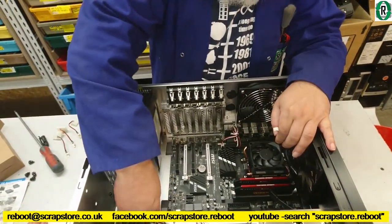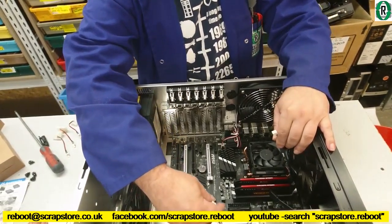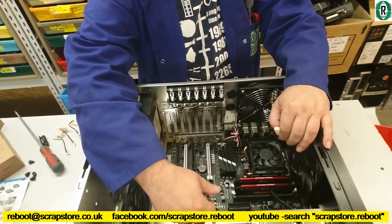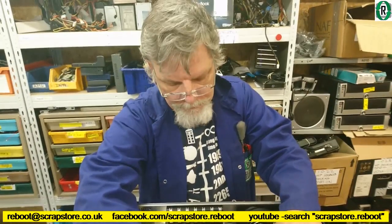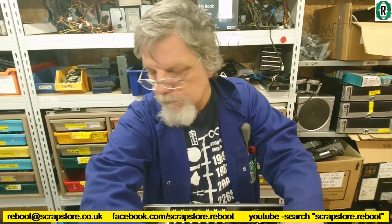How to connect them up. So we've only got two system fan headers on the board. Yes. And three. One, two, three, four. Four fans. How are we going to... I noticed some of them have got Molexes on them. I've taken the Molexes off. We could temporarily go Molex, because if they're big fans, they'll just run at a reasonable speed, maybe, mightn't they?